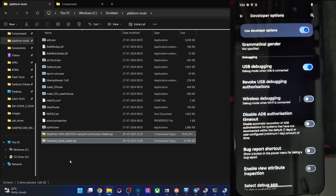In a few seconds we should be in fastbootd, as you can see here. Hit Enter and you can see we are getting this ID. If you're not getting this ID, you need to install the fastboot drivers on your PC — the link is given here. Install the drivers, then use the Windows X shortcut, select Device Manager, expand the Android phone section, and verify your phone is shown there.